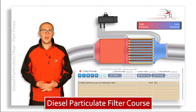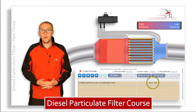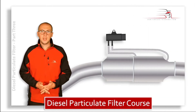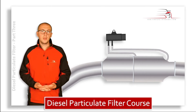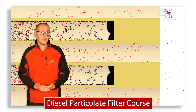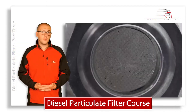If we now look at the actual value while the engine is running at idle, we can see a reading of around 0.5 kilopascal. The problem at this stage is that the driver will be unaware of any fault because the particulate filter will capture the soot particles. Typically, problems like this continue to go unnoticed until the point whereby the filter becomes overloaded with soot.